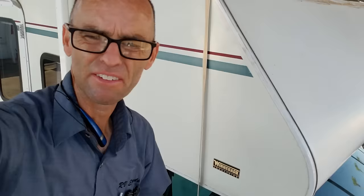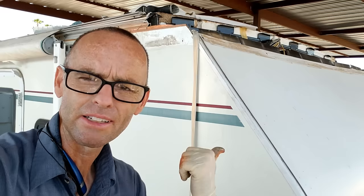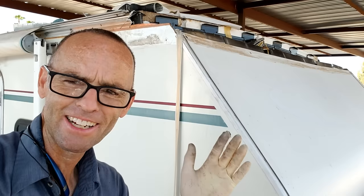I've got lots of work to do on this coach — I'm doing the roof on it too. Relaminating sidewalls is identical to doing the roofs: you have to remove everything and actually do a good job. I know there are epoxy vacuum bonding kits out there — they will stabilize it, but they will not make it look great. I still have to clean this up and reseal it, but I won't reseal until I'm done with everything else so I'm not doing triple the work. I'm really quite pleased with the way it turned out — it was flopping around before and now it's nice and strong.